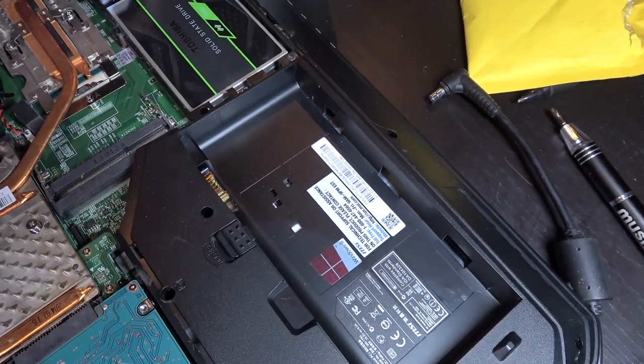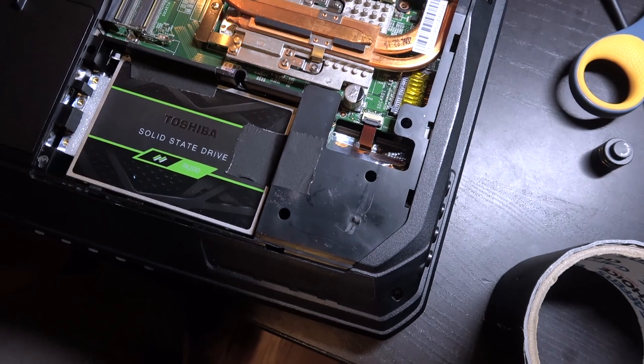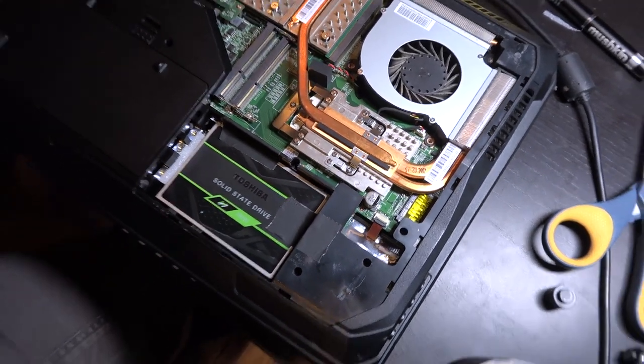This should have come with some sort of sled or brace. If you can't find the screws or can't figure out how to brace it, you can kind of get away with just taping it in there. Make sure it's in there tight and not going anywhere — but this is an SSD, not a spinning disc, so if it moves around a little bit it's not the end of the world. You want to make sure it's really secure. If you don't have all the pieces or lost them, it's okay to tape or glue it. That's gaffer tape. Duct tape can get a little gunky; electrical tape may not hold well. I like gaffer because it's used for stage lighting and is designed to put up with heat better than duct tape, since duct tape has that plastic finish that'll melt.